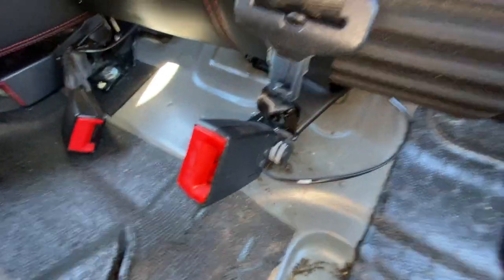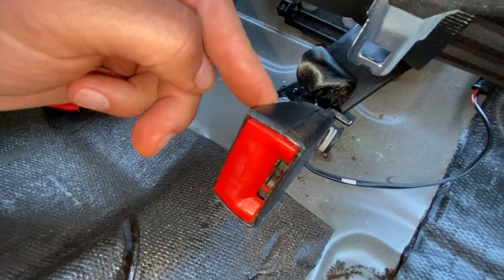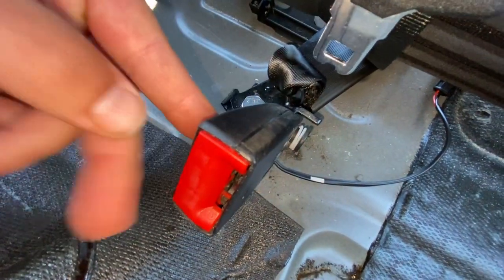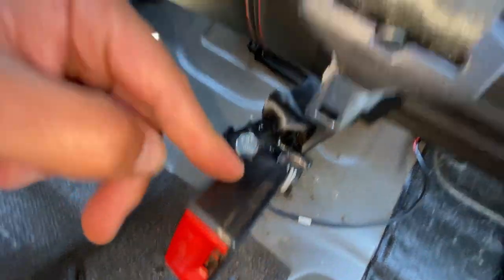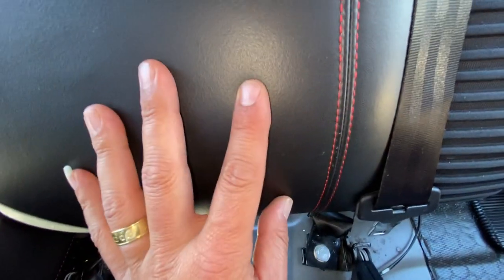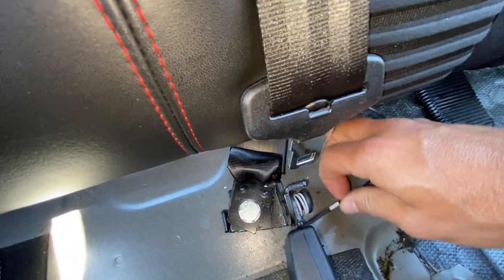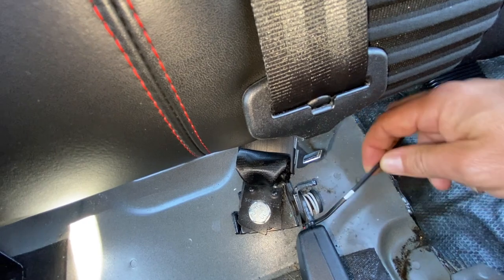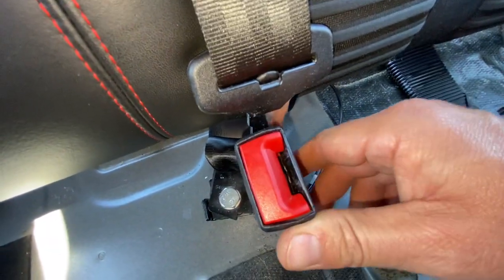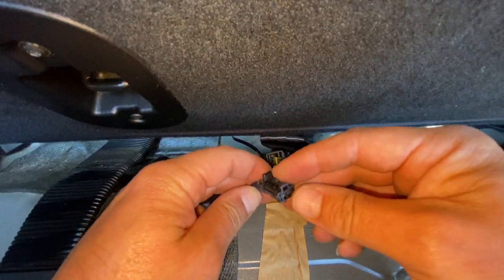Where the cable terminates into the back of the seat belt, they're meant to be a sealed unit. So I'd recommend getting one from a spare parts supplier, or if someone's breaking a car see if you can get one from them. It's realistically just a case of undoing the bolt we saw when we removed the rear uprights. If you've got an issue, look for anything obvious - the cable snagged, ripped, or torn - and if you have to replace it, it's better to replace the whole thing.